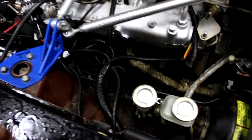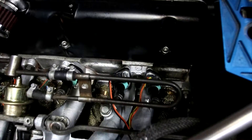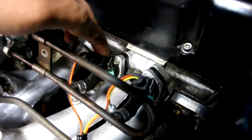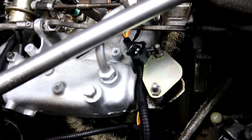So obviously you get a new harness, and the plugs go directly into your injectors. These aren't swapped out — these aren't stock injectors — and they just plug right in. You do get two extra ones because this EZFI kit can be used for a V8, but those aren't used.